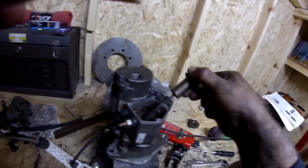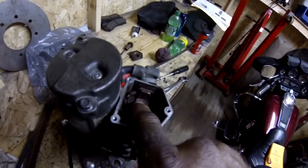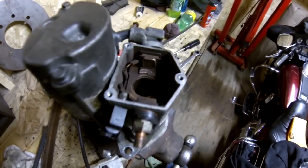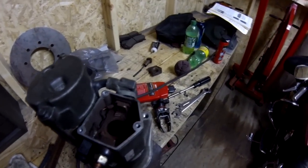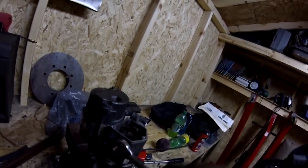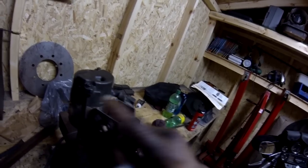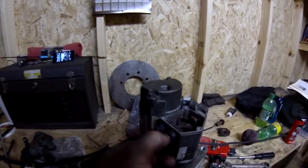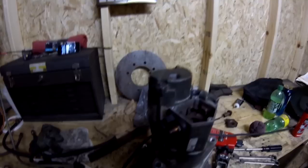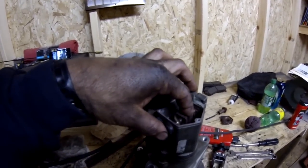What we're going to do is take these three screws out, pop it open a little bit, and take our cover off. Here is the plunger with the spring — we'll reuse the spring. And you can see those connectors are worn out and shot. There are our new connectors. We'll get in there, loosen up this end — trying to do this one-handed while filming — and pull that connector off.